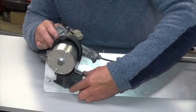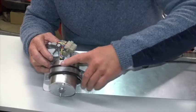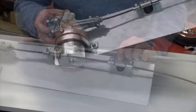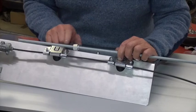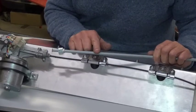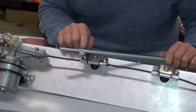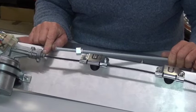That rubber pad sits under the motor, and we bolt it all together. Wiper motor is fixed. So once we have the wiper motor and the wheel boxes mounted, it's time to cut the Bundy tube. The Bundy tube that you get with the kit is flared at both ends and it already has the nut on it fitted, which goes on the nose of the wiper motor.